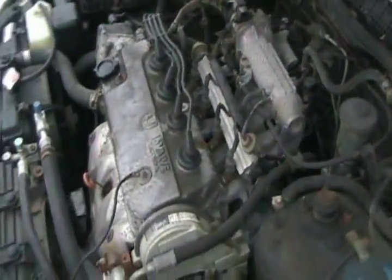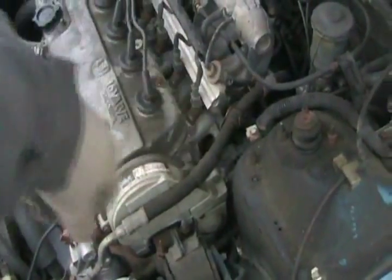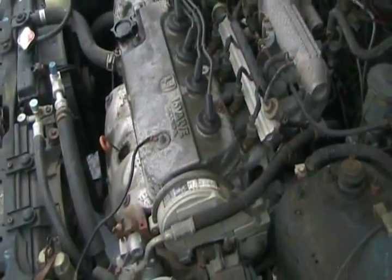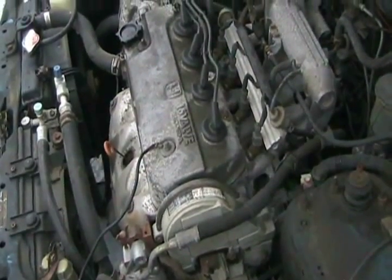On cars that don't have a valley to mount a supercharger into, you have to find some other place on the engine to mount it so it can still be driven by the engine's belts and pulleys. That's why superchargers can't put out as much horsepower as a turbocharger — because they steal some of the RPMs and torque it takes to run your motor in order to run themselves.